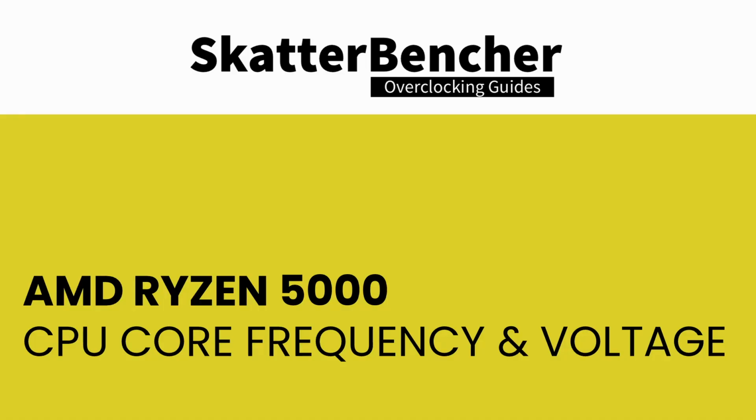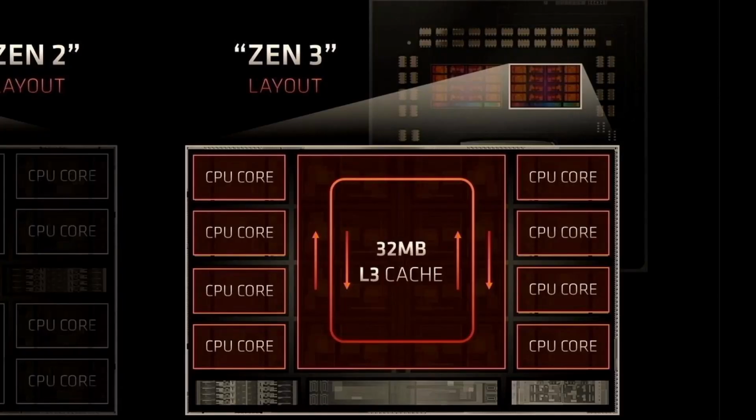As I mentioned earlier, the AMD Ryzen 3 5300GE is part of AMD's Cezanne APU lineup. Cezanne is a single CCD product that features Zen 3 cores. CCD stands for Core Chiplet Die and is just a die on the Ryzen CPU that has CPU cores and a shared L3 cache. The Zen 3 CPU cores are packed together in what's called a CCX or core complex.